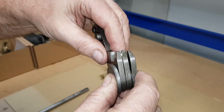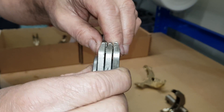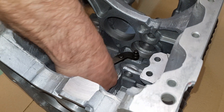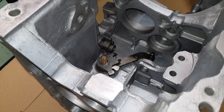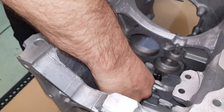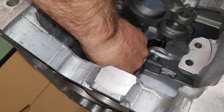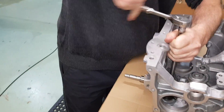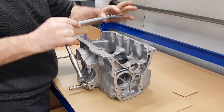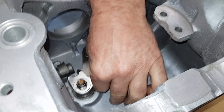If you look at them like that you will see the middle one again has got the double taper. So we'll drop those in now — it just drops onto the big stud in the bottom of the gearbox. There's this extra thick washer that's come out of the gearbox over the top, and then a nylock nut on the top. Wait for the nylock to bite, pull it down. So you've now got the selector spool and your selector forks in place.